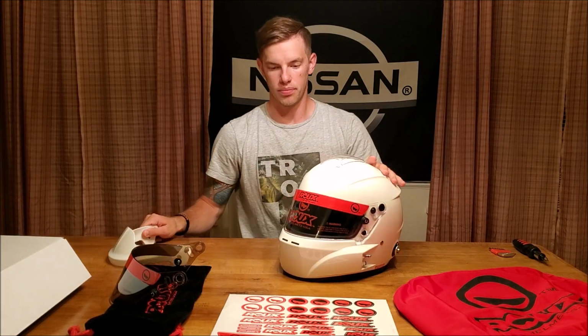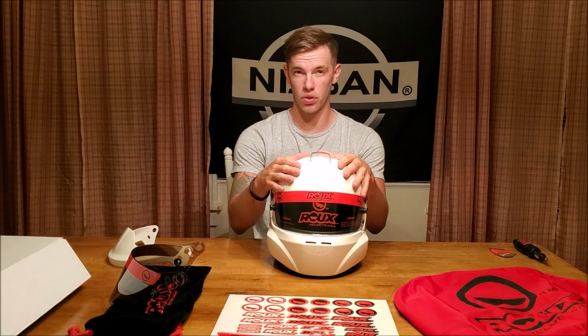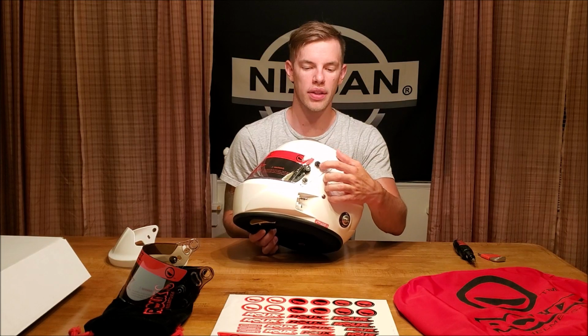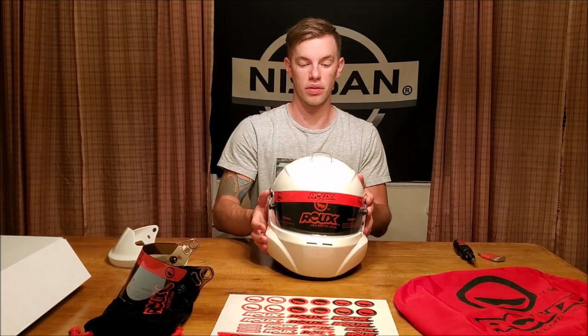So now what I'm gonna do is I'm gonna go around and I'm gonna start taking this lens off and swapping everything over. I'm gonna do this all in one video just for you guys to see the final outcome of what my helmet's gonna look like for now before I actually get it painted. It's pretty simple, right? So for the lenses, all you have to do is get a flathead screwdriver for here and a little Allen key for here on both sides. So we're just gonna remove both of these bolts here to get this lens off.